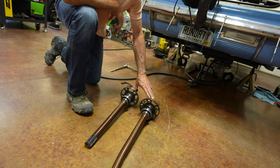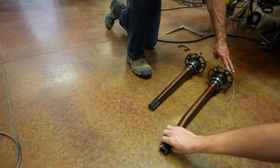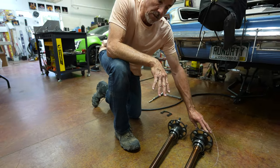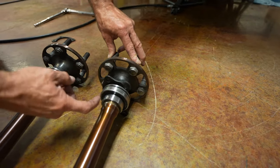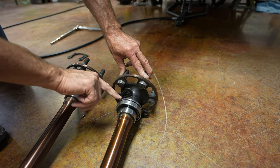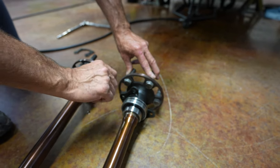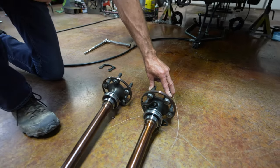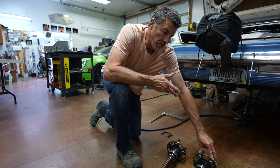So we're out there discussing it, and I did see a little bit of grease come up on the outside through the wheel. That's when James and I were discussing it — let's go up here, let's just maybe make a hit. I was not expecting a bent axle or a broke axle at the time. I was figuring it was probably the seals on my bearing that was leaking right through here, putting some of the grease out, or this O-ring — that was the worst case. So let's just make a 60-foot pass.